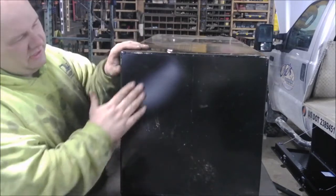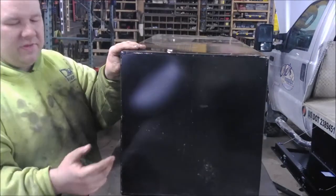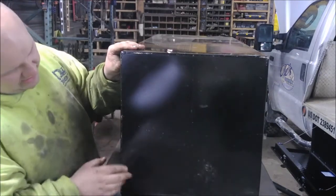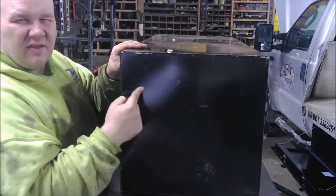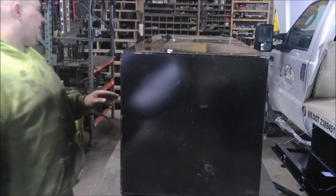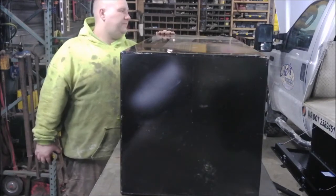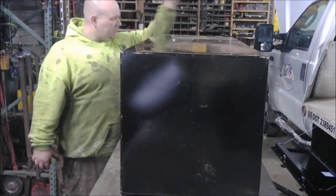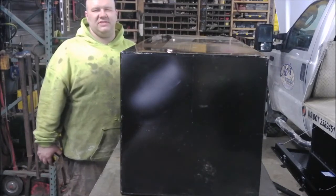The only quality thing I see wrong with it is the end plate here has some distortion in it. There aren't any bumps or dents like something happened in shipping — this looks like an issue with heat when it was getting welded or something to that order. It looks like distortion that was in the panel ahead of time because there aren't any scratches or dents. You can see the reflection in the light — see how that curves? You'd think that would be straight, but the end is kind of wavy. The top and back are really nice and straight. We're seeing the same thing on this other end cap — no visible damage from shipping, everything looks square, but the end plate itself has some waviness. I bought two boxes and the other one has the same. It's a big flat panel without any bends — I think this is maybe some distortion happening during the welding process. Nothing too major.